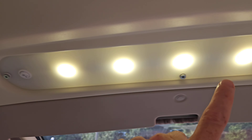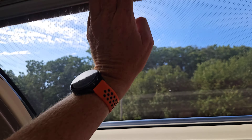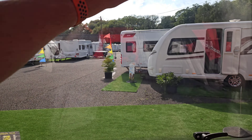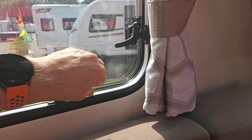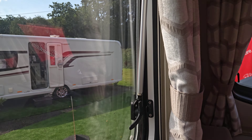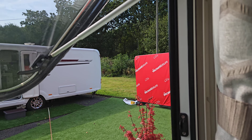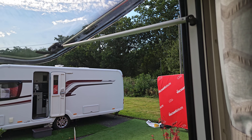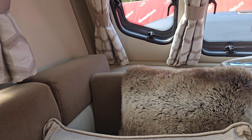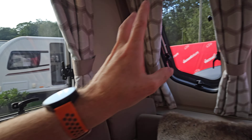We've got our speakers just here, and a couple of light switches over the top. One does the overhead lights and the other does the down light. There are blinds for all windows, and fly screens on any that open. The way the windows open is they've all got little buttons — press one, two, three, four. These are what we call click-clack windows; listen out for the click and kind of drop it back onto the click. You can also lock it on a breather setting — not fully closed — to allow some airflow on a hot day while still keeping things slightly secure. If leaving the van for any period, make sure those are locked properly.